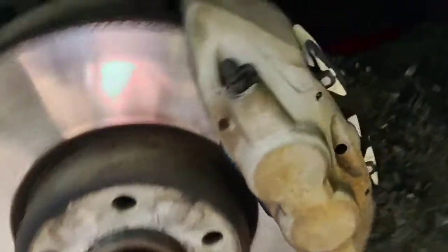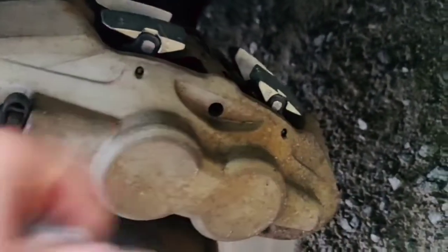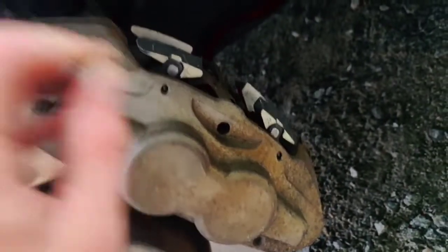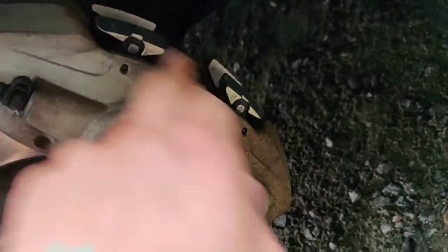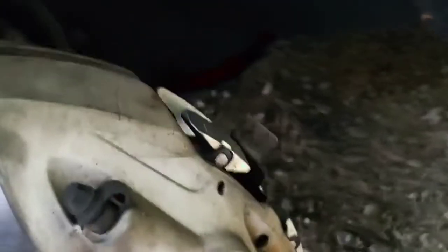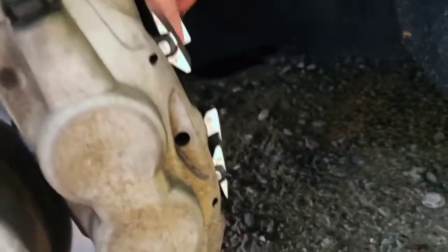The wheel is off. Your brake pads are secured with these pins right here. What you have to do is take a nail, put it against the pin, take a small hammer and push the pin out. Once you push the pin out you will be able to take the brake pads off. Two pins are out, and then there is this bracket that holds the pins and brake pads. Now you can just wiggle the brake pad out of the caliper.